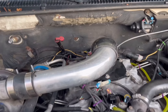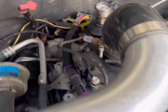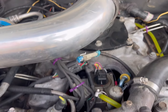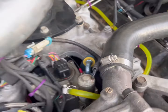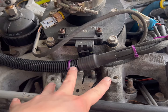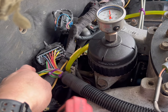Today was the day we finally put our new main harness in — that's supposed to run under the intake. I actually did it externally because I am so tired of taking the intake off to work on this thing. As you can see, I have everything zip tied and pulled up to the top so it's not stuck in the valley where it's already hotter than hell. I zip tied it right here and I want to get some P-clips so I can really mount it up off these two standoffs. Here's our two weather pack style connectors in the back, and everything is up out of the way and not touching anything it shouldn't.